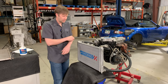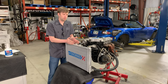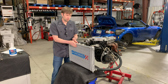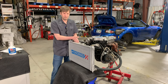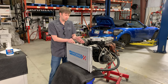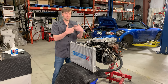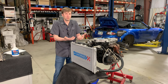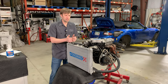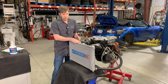There are other details too: the tube and fin count is really high, and it's thick enough to have as much surface area as possible, but not so thick that it impedes airflow. The delta — the difference between the incoming air and the coolant temperature — is not very high by the time you get to the back of a thick radiator. Super thick radiators are great for coolant mass and for taking a long time to get that coolant up to temperature, so they can lengthen the amount of time it takes to overheat. But once you're in a steady state, they can't shed the heat as efficiently. So step number one is a good radiator.